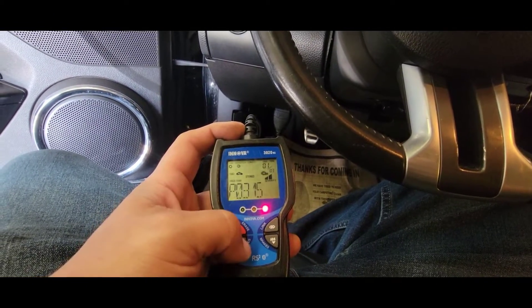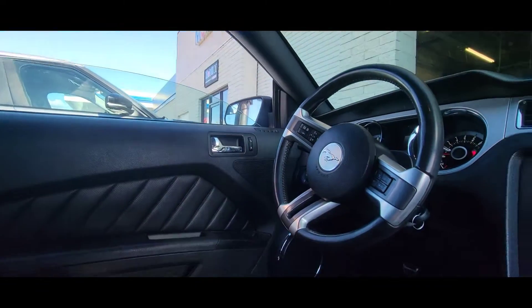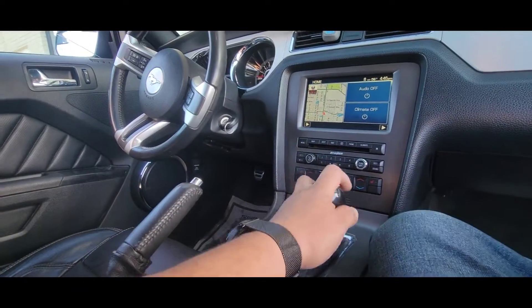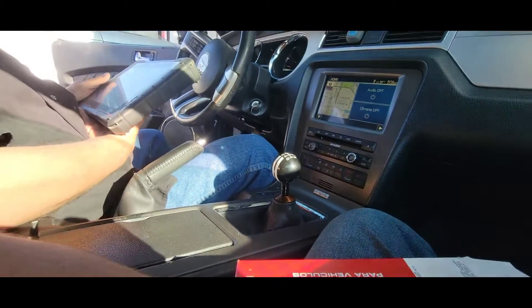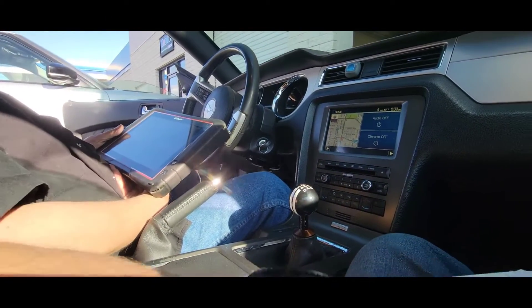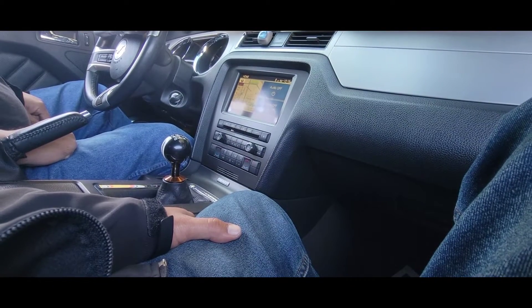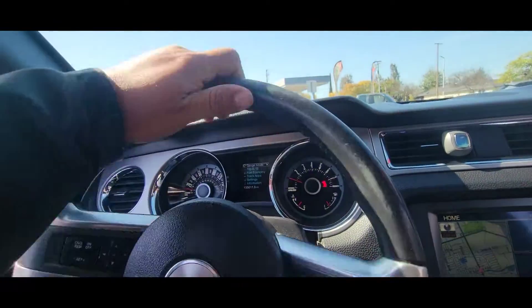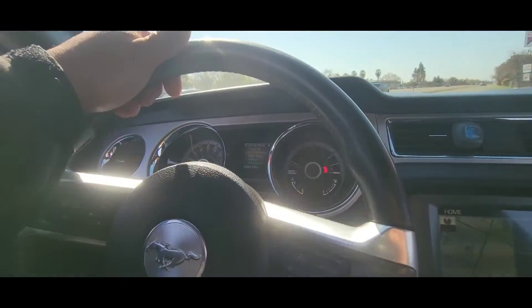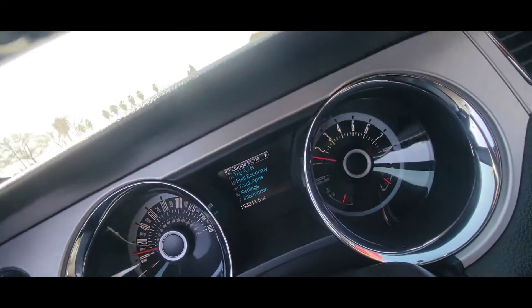Here at the shop, this guy helped us out with a $15,000 scanner to do the relearn. Hopefully we're able to reprogram it — if not, Motorcraft here we come. And there it is: that P0315 is clear! So we had to replace the crankshaft positioning sensor and do the relearn. The first time we tried to do the relearn it was not reading correctly, but we installed a new one and it works.